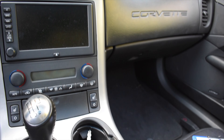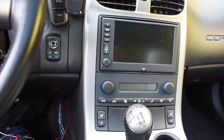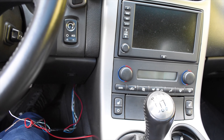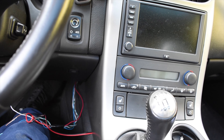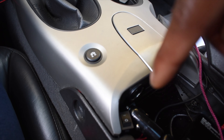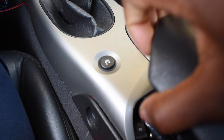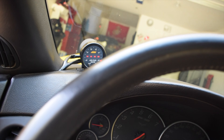On the Corvettes, we have power supplies that stay on even while the car is off. You want to make sure that you're tapping into a power supply that shuts off when the car is off. My brother took the easy way out and just used a common switch, so he just switches it off when the car is parked — but you just can't forget to turn that off or you might drain your battery.